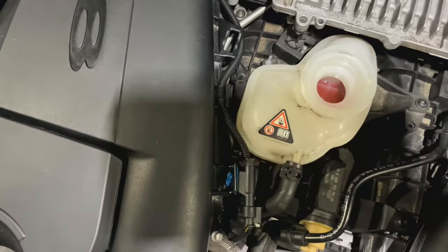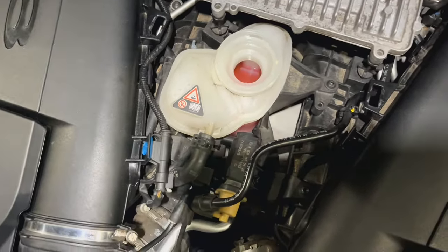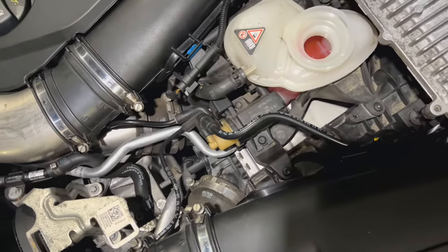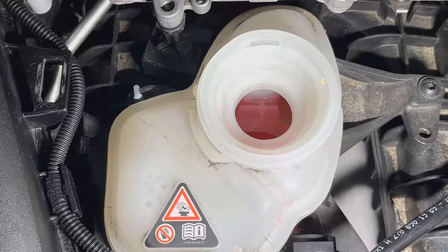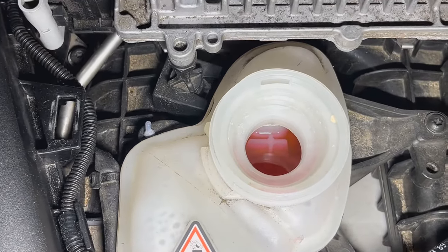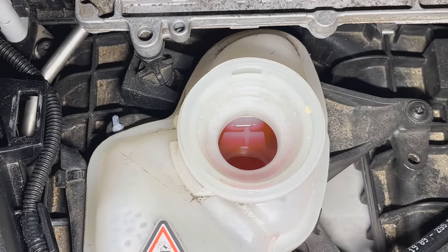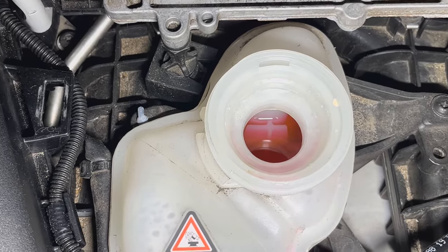As I said, these are two complete separate systems. You're going to have to add coolant on the other reservoir as well. Here's another close-up — you see that little plastic piece that has like a cross form sideways? That's your level. That's where you should keep it.